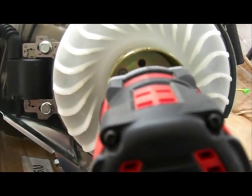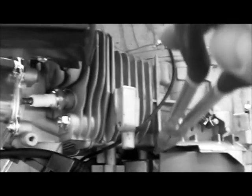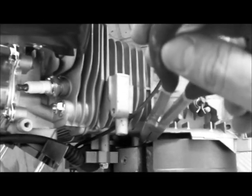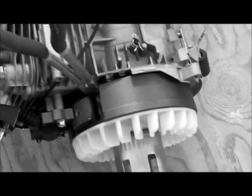I'm going to undo this bolt using an impact driver. Just to warn you - it took more than my electric ratchet could handle. What I did was slip a pair of pointy-nose pliers against that little stem and hold the flywheel against it so it couldn't rotate, then put my ratchet in there and broke the bolt. There's quite a bit of torque on that bolt - much tighter than it should have been. Once you get the initial break, you can ratchet it off no problem, but you have to brace it carefully.